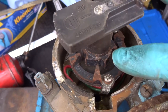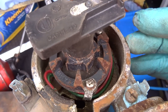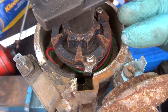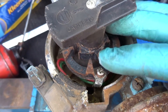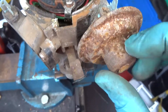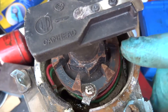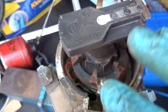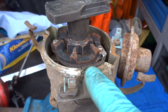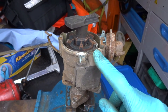We have to take all this off because we're going to put in a pickup - we're going to use a cam pickup but we're going to use a distributor to mount it because it's easier. All of this bob weights in here for advancing and retarding ignition, and we've also got a diaphragm for advancing and retarding ignition depending on the pressure in the inlet manifold. So all of this is going to be taken out and then we're going to mount a cam pickup probably in here somewhere.